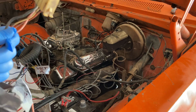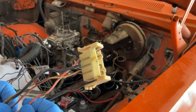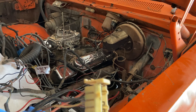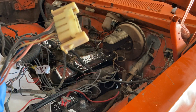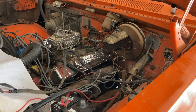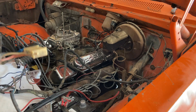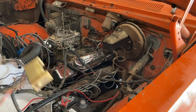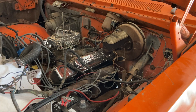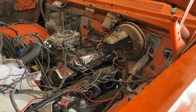Between those three harnesses I'm going to try to find all the pieces to put this together. I'm not opposed to splicing below the bulkhead and getting all the wires nice and tucked together, but I'd rather have a continuous piece — every splice is just one more point of failure to troubleshoot. I'm going to take inventory of what I have and figure out how to move forward. If you're dealing with a Frankenstein truck like I am, that's just the nature of it. Anyway, this is part one to level-set on what we're doing, and I'll have multiple parts — thanks for watching.